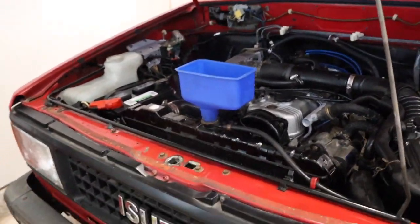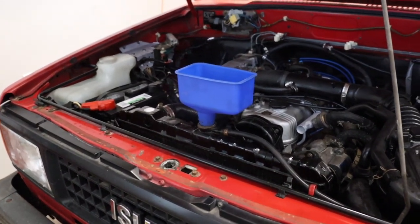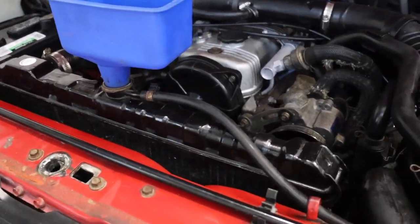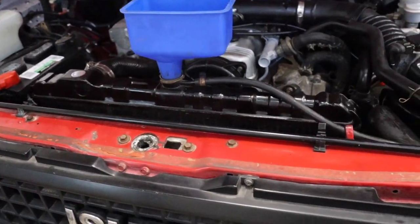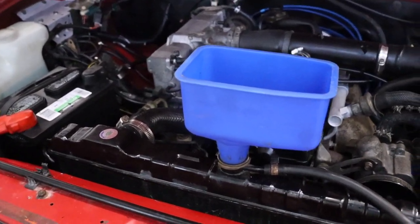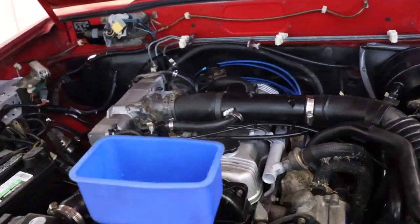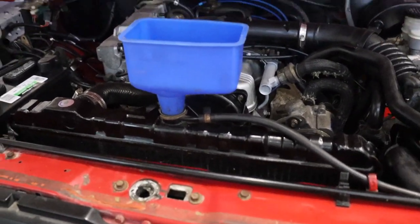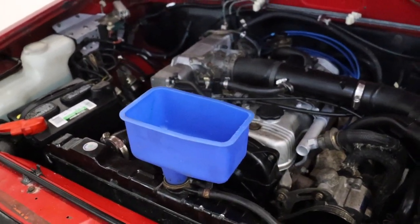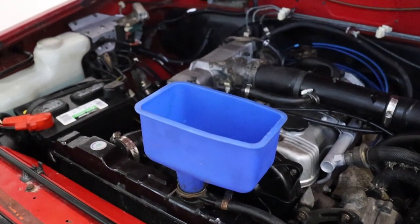It's interesting that it was mostly water that came out — that would definitely lead to that rust situation. Next step before we can run the de-rust liquid through the system, we're going to do a hose flush of the radiator, because that's where a lot of rust and contamination tends to collect on these older vehicles. See what we can dislodge by running the hose through, then reconnect our lower radiator hose, top the system up with fresh distilled water, and run it through one or two heat cycles. Make sure it goes through everything including the heater core — we'll turn the heat on full blast.